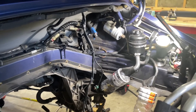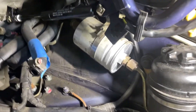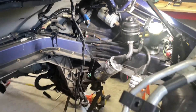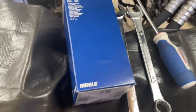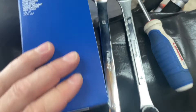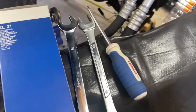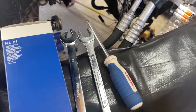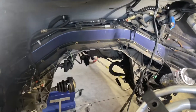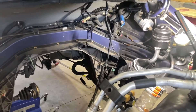Welcome back to the Bearded Garage. Right now we're going to be working on the fuel filter, which is that silver canister right there. In order to do that, we're going to need a new one, two 19mm open end wrenches, and a Phillips screwdriver. And then we're going to do a couple other things so we can prep for putting the motor back in the car.